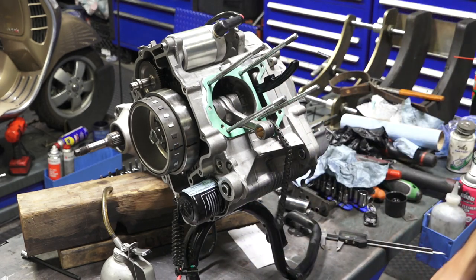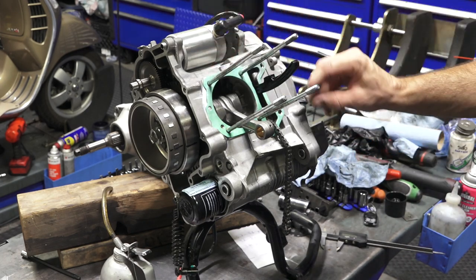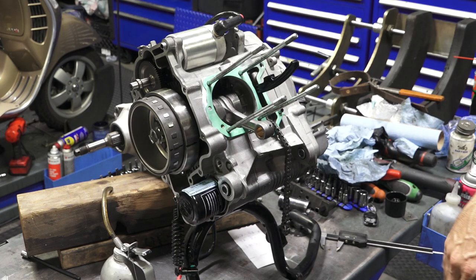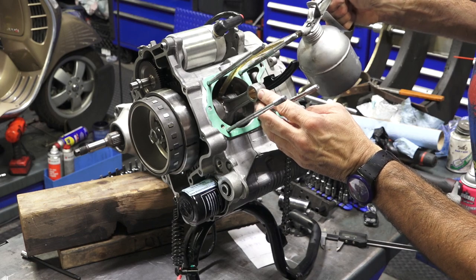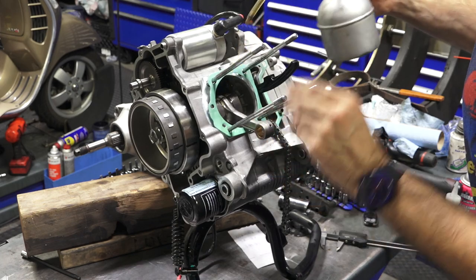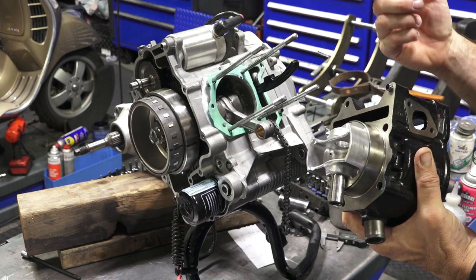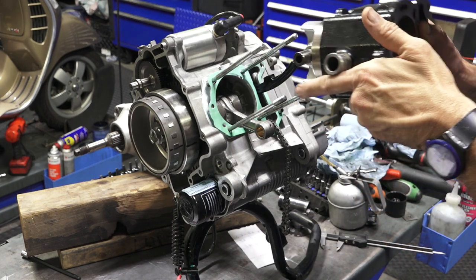If you're doing the 350, which is kind of a completely different motor, they do recommend replacement. And the surfaces are all cleaned. I'll go ahead and put the dowel in there. I'll squirt some oil on the big end, just like in those grooves, kind of give it a little pre-oil. The one dowel is still in the piston. A lot of times if they're rusted, you'll end up destroying them, removing them. I'm just gonna leave that one alone. I installed the dowel down there, so that's good to go.